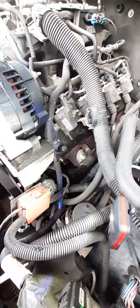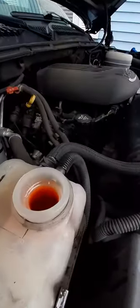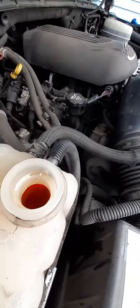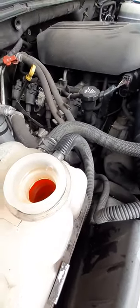We're good — the temperature gauge is reading. I've got the cap off the reservoir so it can bleed the system, get the air bubbles out, and let the temp get to the normal reading. It wasn't working before — just sitting flat. And there we go: it's reading at normal temp, just below 210, which is right where it's normally been for the last 10 years. I've had this vehicle for 10 years and know it well. You can see it releasing some air bubbles as it bleeds.